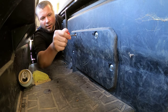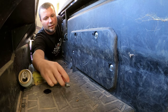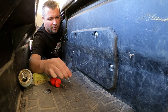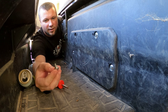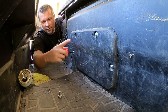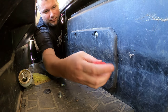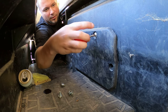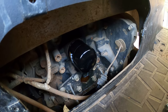I accidentally turned the camera off before I did this part — changing the oil filter. You've got these little Phillips head screws, and they have a directional washer on them. The washer has to go on the screw so that the thin, narrow part can go inside the plastic and center it. Just remove these screws and inside is your oil filter — which I've already removed and replaced.